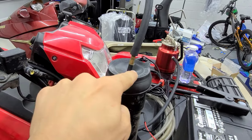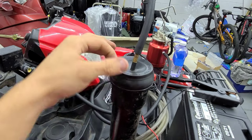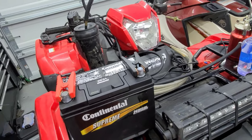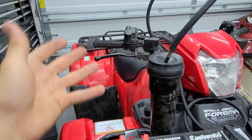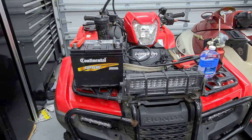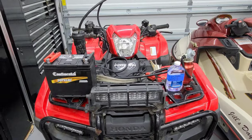I've put on a 2-inch quick cap from Home Depot or anywhere you want to buy it from, or you can actually buy the fittings that they sell with that machine, which you can buy a smoke making machine at any time. And you can just put mineral oil into it and it will produce the smoke, and you'll see where your belt box or anything could be leaking from. Not just, this can find vacuum leaks, anything. It's for automotive use, you know?